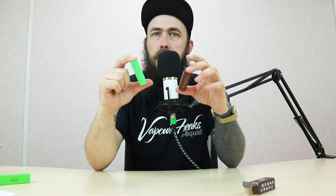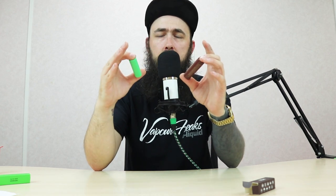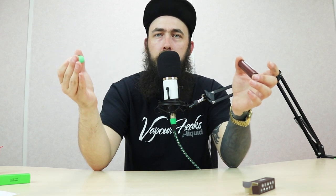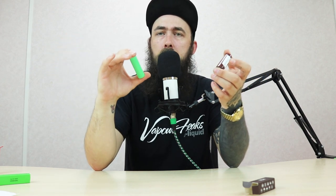Always pair your batteries. Even if you've got a set of batteries and one of them is gone, replace two at least so you've always got paired batteries. That's just the safest thing to do. The more you cut down on potential errors, the safer you're going to be long term. If you've got four batteries and one of them is a bit knackered, you always replace two so you've always got a set of paired batteries.